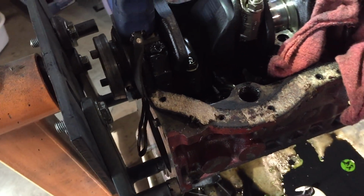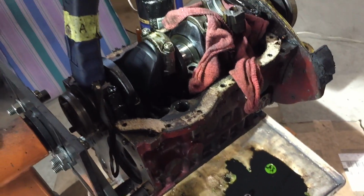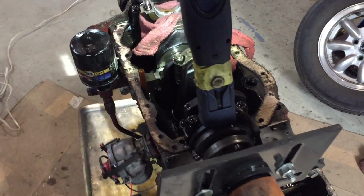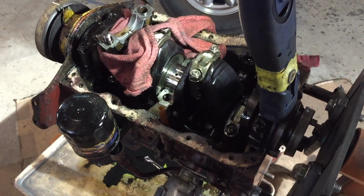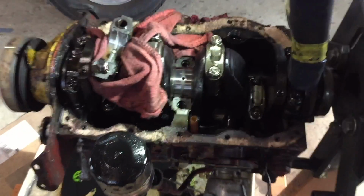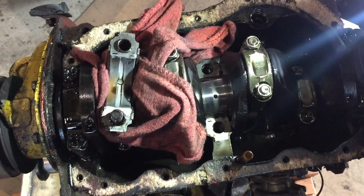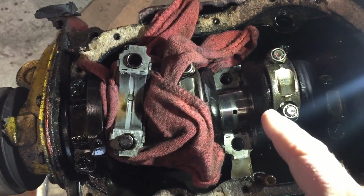So we've got to change the camshaft here. No problem, we have one in stock. A nice 1275 cam for this 1275 engine. And he's going to need new tappets to ride on that new cam, so we have a nice relationship between cam and tappet. But check this out, this is the main bearing cap that lives there.